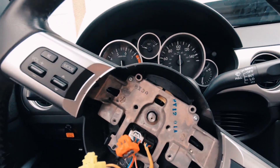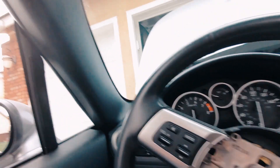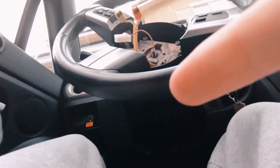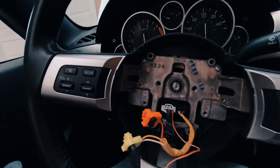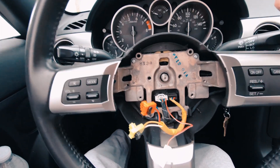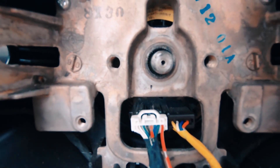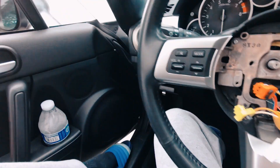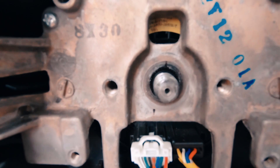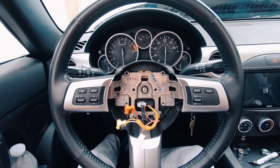Now I need to try to unlock the steering wheel and center it. So it's unlocked — try to center the wheel while you take it off. And just get some white out or a sharpie to mark the splines. I marked it with a sharpie, though I don't think that'll help because it's already marked on the wheel. Moment of truth — does it pull off?